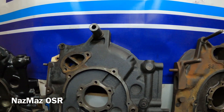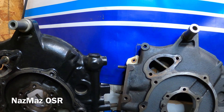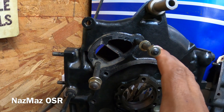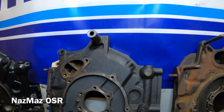Obviously the water pump is not interchangeable going from '73 to '74 because of different locations — the front cover and timing cover just won't sit right. When it comes to the 10A and 12A, it's very similar and interchangeable; they both sit on the side so you could just go ahead and swap these together.